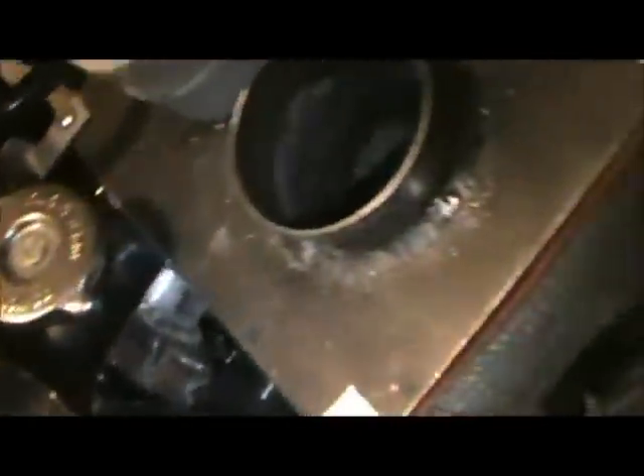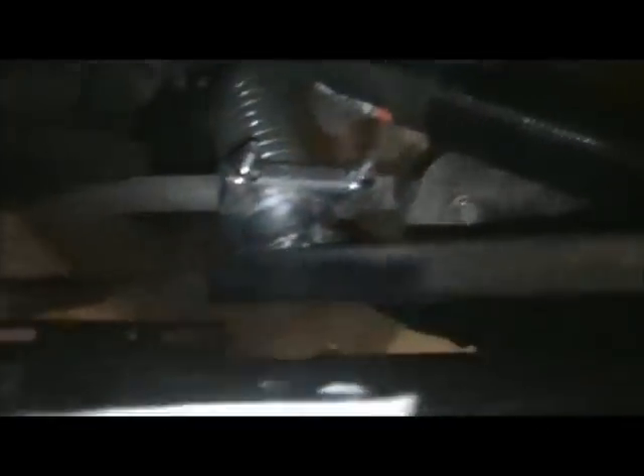This right here, if you can see down in there, is the vapor outlet. The vapor flows through the bottom, surrounds the container, and then comes out on this outlet right here, which connects to this piece I made — it's a piece of rectangular tubing, narrow enough to fit in all this space. Then it 45-degrees down so I can connect to the pipe on the exhaust. You can see that fitting right there — it's the same on the other end but in a 90 instead of a 45.